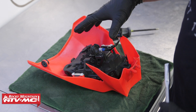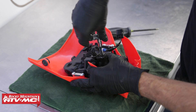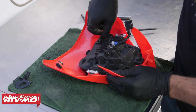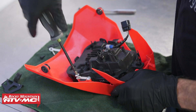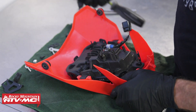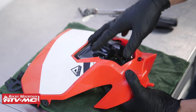We need to remove some hardware from the stock headlight unit. We've got this bracket here — we'll go ahead and take that off using the T20 safety bit, which has a hollow point because these screws have a pin in them. Now we have four Phillips screws to take out, and we'll remove the aluminum brackets with them. Then I'm going to flip this assembly over. We've got an adjusting screw on the bottom, and I'm going to loosen that all the way while holding the back of the headlight so it doesn't drop out.